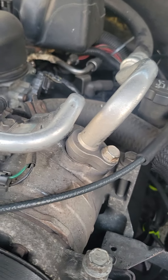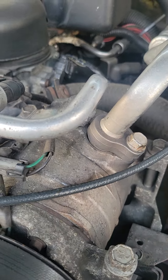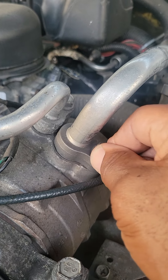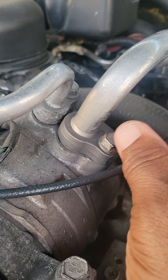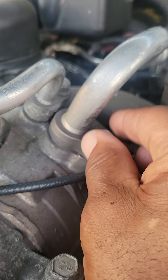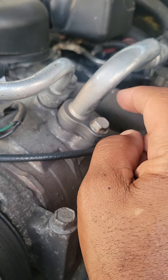The most common reason I've found for leaks is after people have done their own repairs — they replaced an AC compressor, a line or a hose, and forgot to tighten a connection port down, forgot to put an O-ring back in, or forgot to check if the old O-ring was busted. Whenever you're replacing something at a connection port in your AC system, there will always be an O-ring. I highly advise you to use a new O-ring. Before you bolt anything down, get yourself a can of PAG oil — coat your new O-ring first.